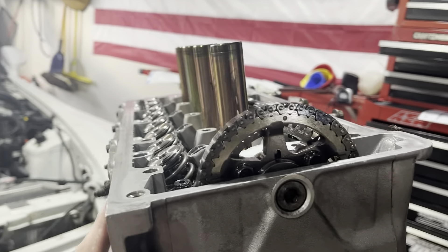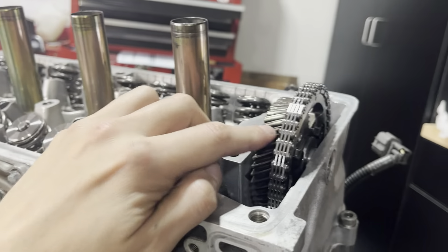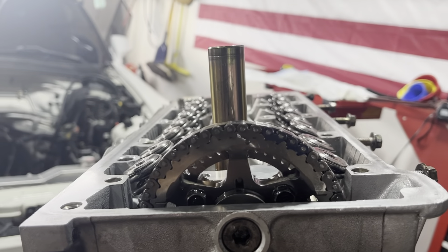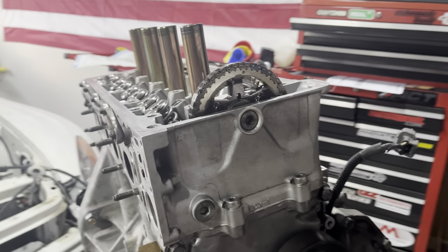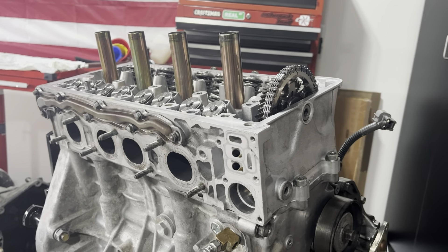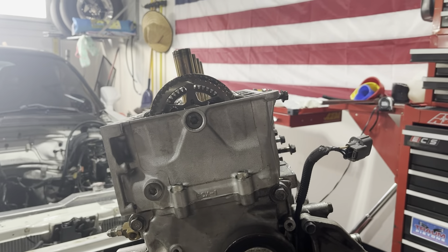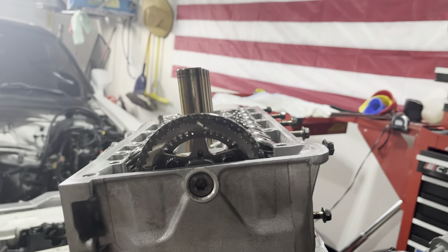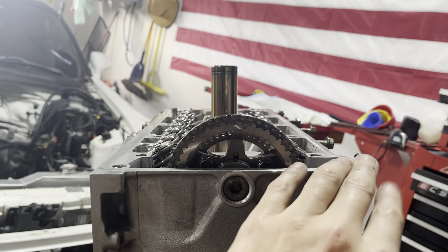When you put your cams in, you'll see the cams have two little marks. Once you get them along this gear, if you're lined up here — which means you're all top dead center — and your cam marks are lined up, you're good to go. F-Series is pretty easy to get timed up. A lot of guys have issues with it, but it could be because the motor sits in there kind of cockeyed. Guys think the lines have to match that angle, but they don't. You have to tilt it and make sure everything lines up even with the deck. Alright, let's go ahead and get this valve train on.